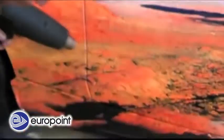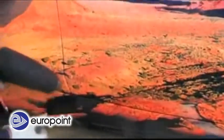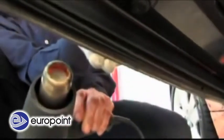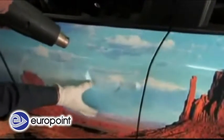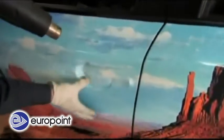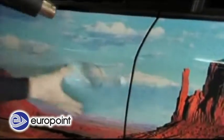Great care is required when dealing with preparation of the bottom part of the sill, as it's exposed to particularly heavy soiling, such as street dirt, or tar or de-icing salt deposits. The recessed grips are heated slightly and the vinyl smoothed into them by hand. This difficult operation may also be performed with a calendared Oracal vinyl.